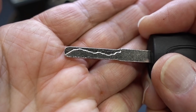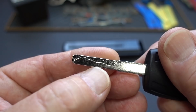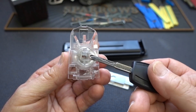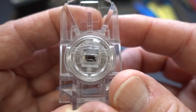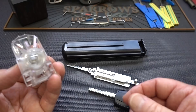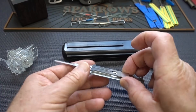Let's take a look at the key first. You notice there are cuts on this — they could be for wafers or they could be for sliders. In the case of the Ford Focus, they're going to be for wafers. There are 10 cuts on the bottom and 10 cuts on the other side as well. You might think that's just for the customer's convenience so he doesn't worry about orientation, but that's not the only reason. What the key doesn't tell you is that there are wafers on both the top and the bottom, not just all on one side. There's no way to know how many wafers are on top and how many are on the bottom until you slide your tool in and start to figure it out — it may be 5 and 5. With a key it doesn't matter, but when we start to pick it, it certainly does.